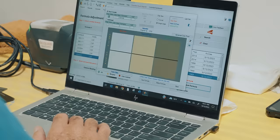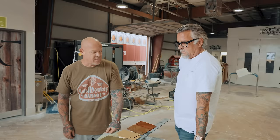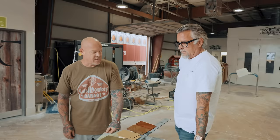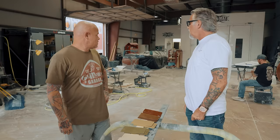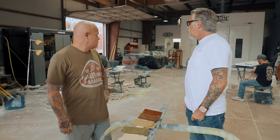Our camera will do what we call a hit on a hit. I can re-read our spray panels and it'll see what it made versus the originals and remake the adjustment because it knows it didn't get it close enough. Back in the day, we used to have to just put a little bit in, check it, put a little bit in, check it. We might still have to do a little of that, but once we do it, all the weights will be recorded as the same formula.